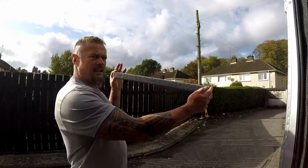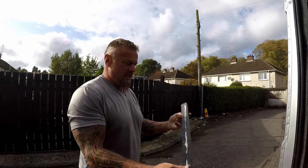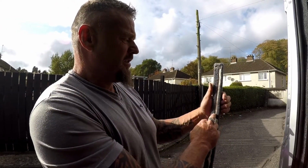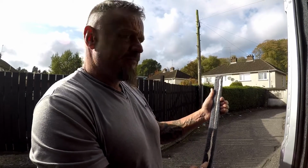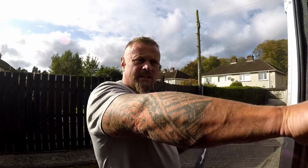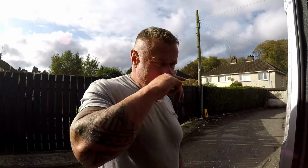That'll fix to the wall better, and it'll also let the gap along here. So we're putting glue along here, liquid nails, and then we'll cut a slice in the carpet too. So it's going to be bonded plus screwed. So really good fixing.